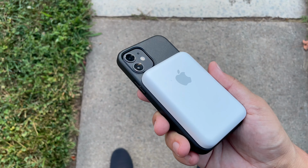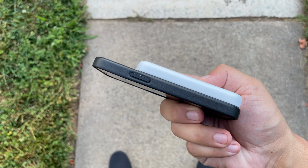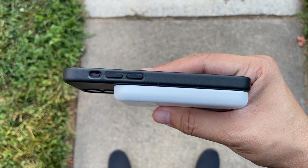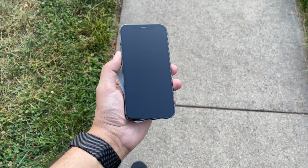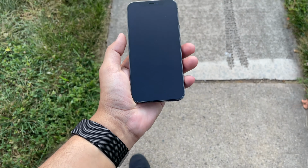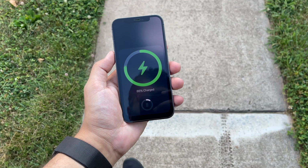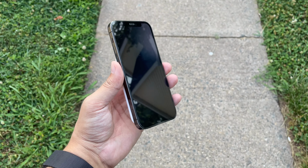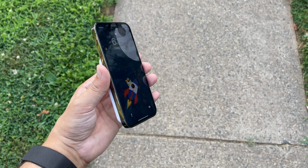When you go out and buy the Anker, they're a great company. I have nothing against them. Matter of fact, I would rather buy a traditional power bank from them and charge via cable as opposed to their magnetic one. Because what's going to happen when you slap one of those other magnetic battery packs onto your iPhone's back, it's going to consider it as a charging source. Your software isn't going to recognize that this is a MagSafe battery pack. It's just going to think that it's being plugged in. So now it's running full throttle, which is going to generate heat, which is going to be detrimental to the health of your battery. So there's a little bit as to how this works. Now, whether you like this or whether you still want to go out and buy another battery pack, that is totally up to you.